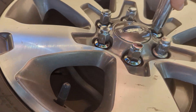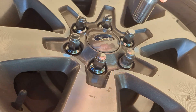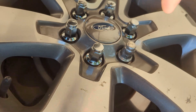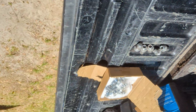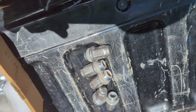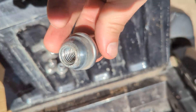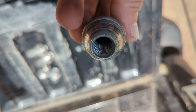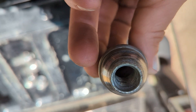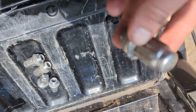Okay, that one's tight. I use a torque wrench. Those are tight, and as you can see, that's what the new ones look like — besides that one different size. But those are the new lug nuts for a Ford F-150. Here are the old ones. Threads look really, really good comparing them. I don't see anything shredded in there — no pieces missing, no pieces of metal hanging off anything. I'll keep these.